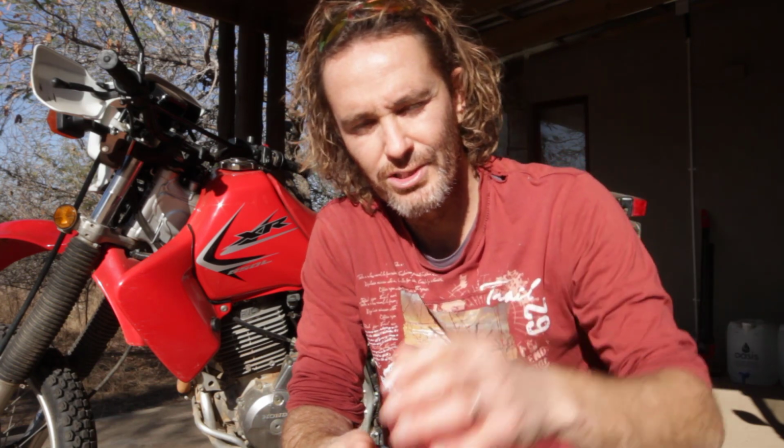I also Googled, and that is the worst thing you can do, because now you Google crank no start on Honda XR650L, and there's a whole lot of posts on CDI problems. You have to change the CDI, it's $150, or the pulse generator. Now, yes, these things can fail, especially the CDI on these. The solder joints are not great. So I worried that this was my issue, and I didn't want to test further in case that was the issue and I had to spend a lot of money and wait for parts. Anyway, that's why I left it for a day or two.